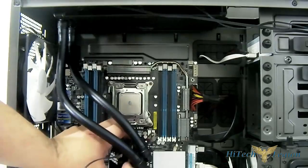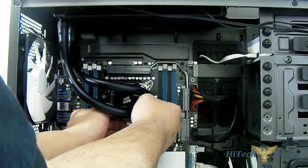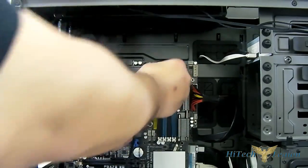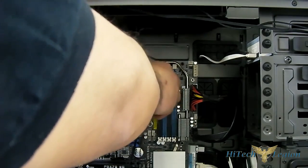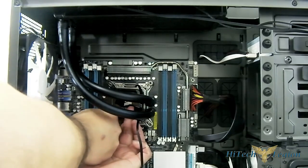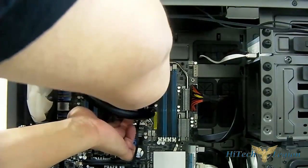You don't need to use much thermal paste. Make sure you have the Intel bracket — the magnetic bracket — in position, and just maneuver it in place. It is a lot easier to put in than the H100; the H100's bracket was a lot snugger. Take the thumb screw and, just as we did with the AMD and Intel LGA1155, screw it in. Don't do it all the way at once — do it corner by corner, a few degrees each time. I'm not letting go of the pump because I don't want it to smudge and introduce air into the CPU area.